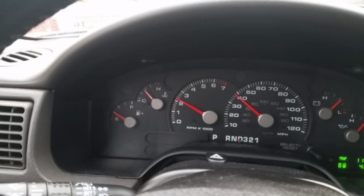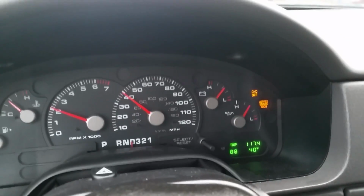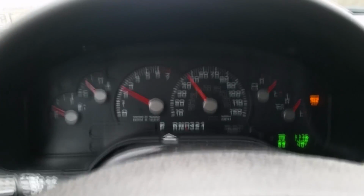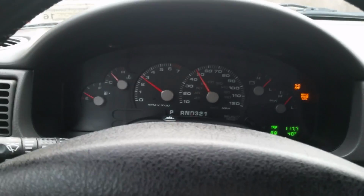And occasionally you'll have the four-wheel drive high light, if you have the four-wheel drive model, flashing on and off with the overdrive light. I call it the light show because you have 3 lights lit at any given time on your dash, and really nothing even close to major wrong with the vehicle. What can be wrong is that you have to be careful with how it shifts. For instance, I don't just floor it to the ground, otherwise it'll go right to red line before it shifts. I have to let off and let it shift, and so on.